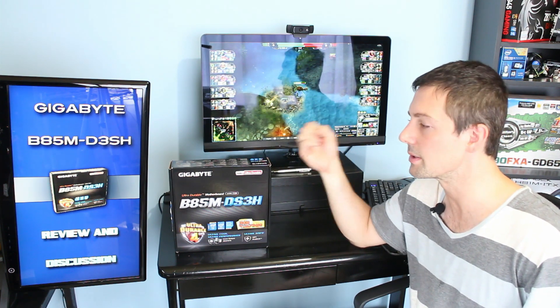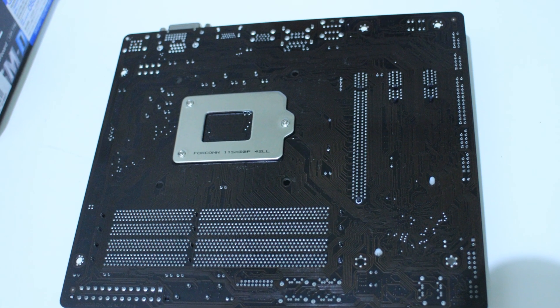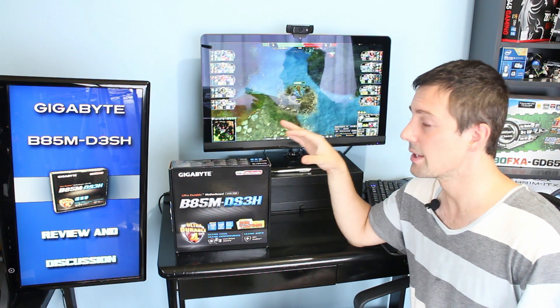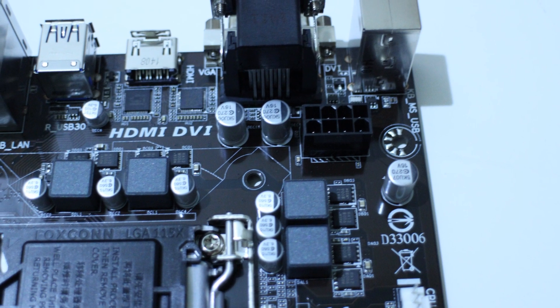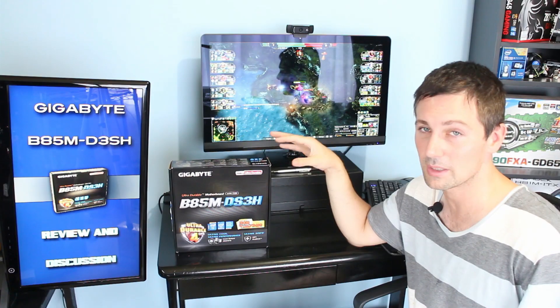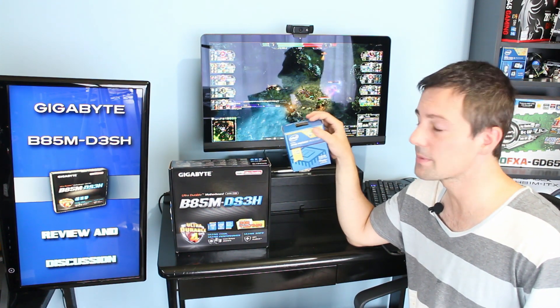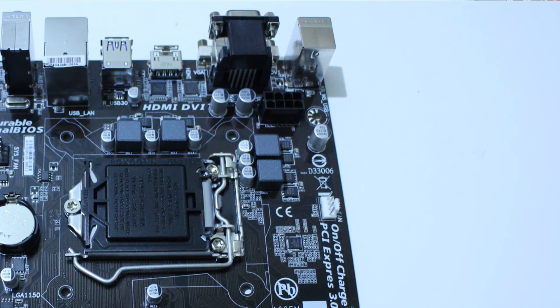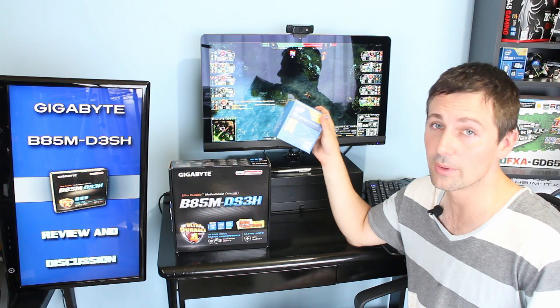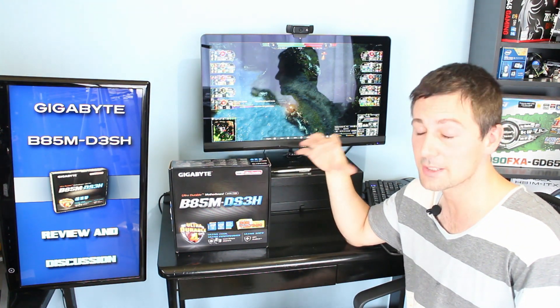The black on the front and rear looks really good — it's a nice jet black, not brown. Looking at the main board itself, it appears to feature a 4+2 phase power design, which is ample if you're going to overclock a 3258. You also get two 4-pin CPU connectors, giving more solid power delivery than an H81M motherboard would. That's the main reason I'm recommending this over the H81M — it's simply a more solid and stable motherboard for the job.